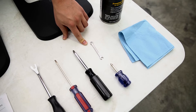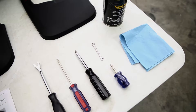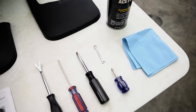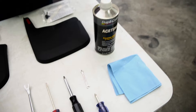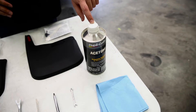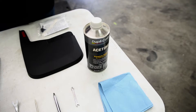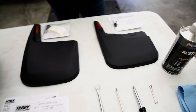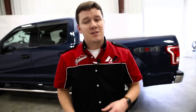We also have a 5.5 millimeter wrench for the front mud guards, which helps us remove those factory screws. Without this, you really couldn't remove those, so make sure you have that handy. The last thing you're going to need is some sort of cleaner or solvent to clean off those areas for your 3M adhesive or your film protection strips — we use acetone. Clean those surfaces off so those things adhere very well and stick for many years to come.